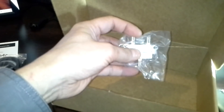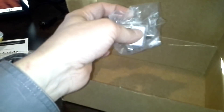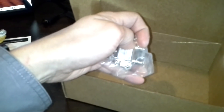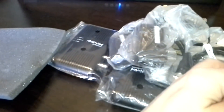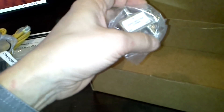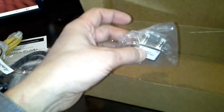It also comes with a splitter for coaxial. You'll want to use this splitter if you're hooking your TV up to this as well. So you come in from the wall — if you had a TV, come in from the wall to the splitter. Then you take one split to your TV cable box and the other one to this ActionTech unit. That way your signal doesn't get scrambled going to your DVR box; it'll go in there separately.